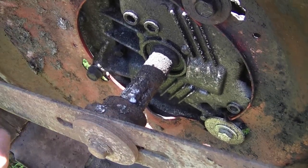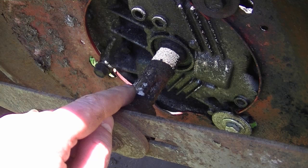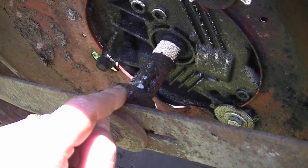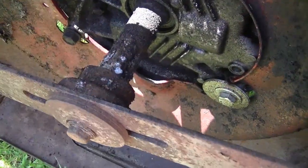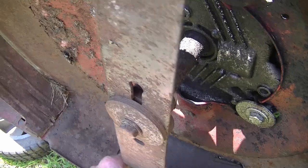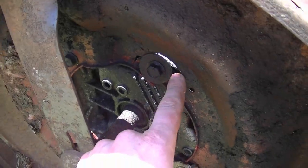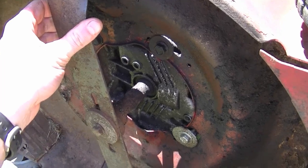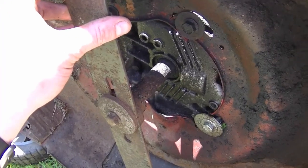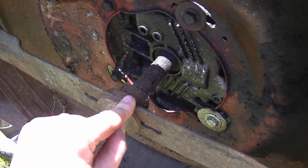Some YouTubers have also asked: when looking at a lawnmower, how can you tell if the crankshaft is bent? When you flip it over, take a good look at the shaft — if you see it moving back and forth, the shaft is bent. When I spin the blade on this mower you can see it's uneven, which causes excessive vibration. On this mower the motor mounts have all broken off and cracked from the vibration. When buying a used mower, flip it over, turn the blade, and make sure the shaft is nice and straight. Before doing this, make sure to disconnect the spark plug for safety.